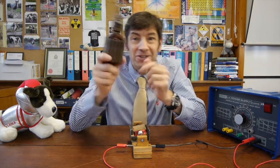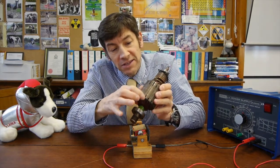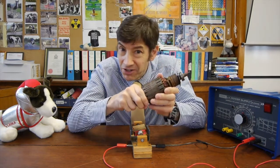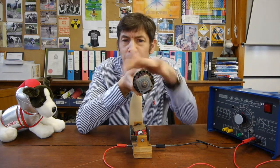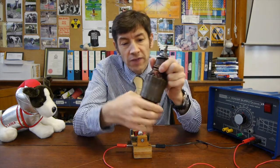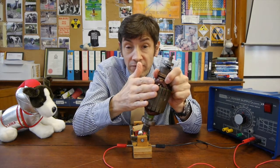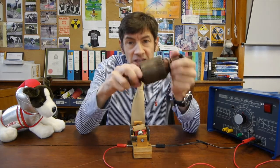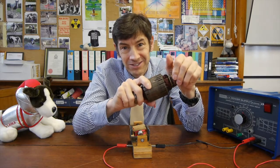And why I brought this out partly was to show you, I don't know if you can see it on the camera, but there are some bits of metal missing from the heavy rotor. That should be the subject of another video, really. That's because you'll notice the shaking, because it wasn't totally balanced on either side. One side's heavier than the other. So they cut out bits of metal where the rotor is a little bit too heavy to make both sides the same mass, and if that's the case, it won't shake a lot when you use it. It's dynamically balanced.